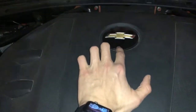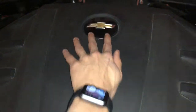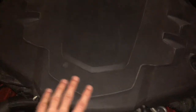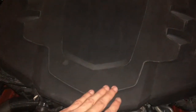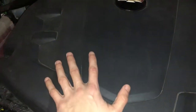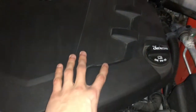Once this is off I'd like to see if I can customize it further. I'd really like to get this bowtie here to match the bowtie on the car. Once you get this off, you're going to want to clean it with some soap and water, scuff it up a little bit, then clean it again with soap and water. Then it'll be ready for the adhesion promoter and the following steps.